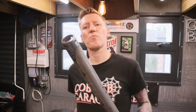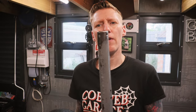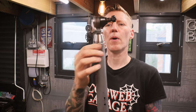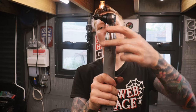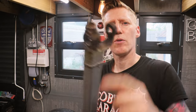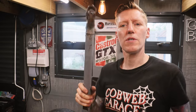I've got these ends pretty much prepared - I've gone for four holes all the way around. The bung goes in and has a tie rod end which connects back to the frame. I need to weld that on the end, but first I want to tidy up the cut end of the wishbone. I cut this off really roughly before, so I want to round that off and pretty it all up.